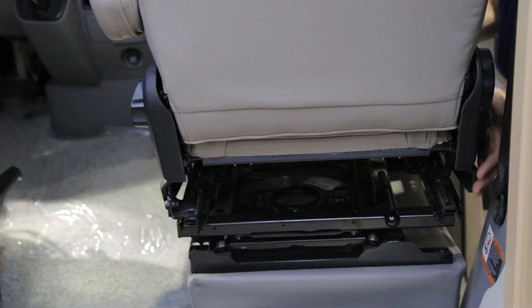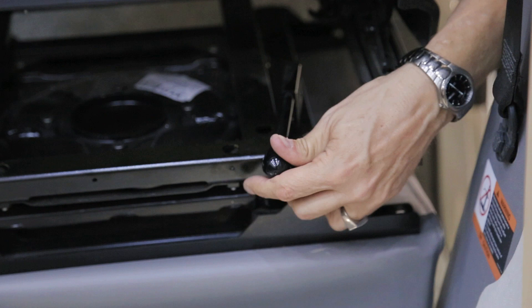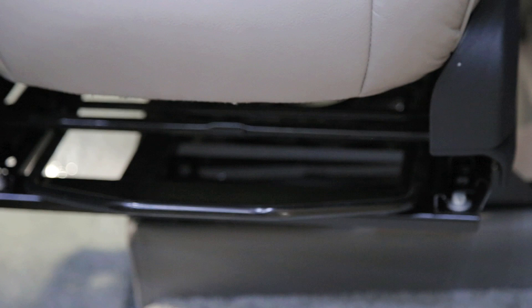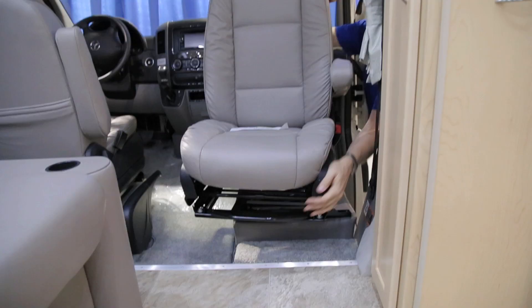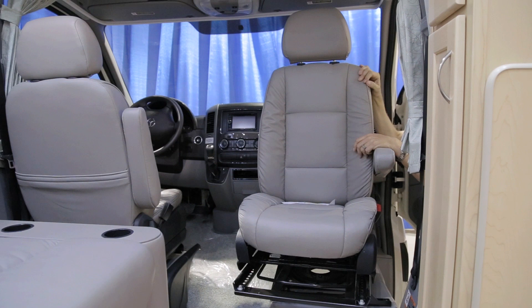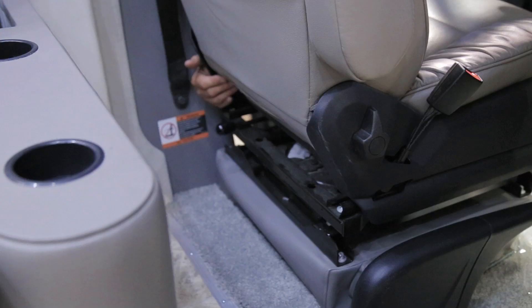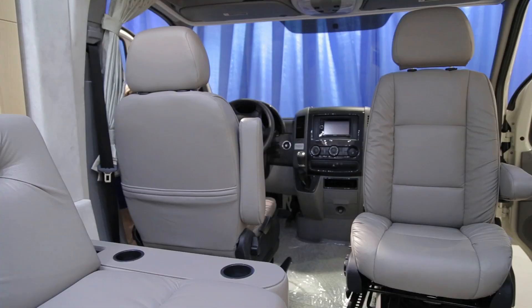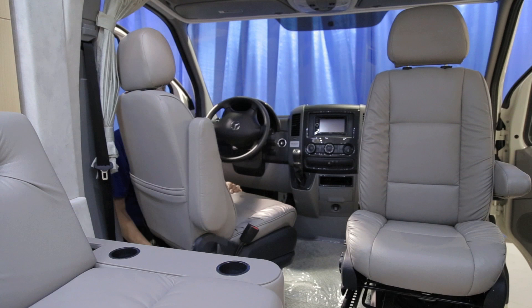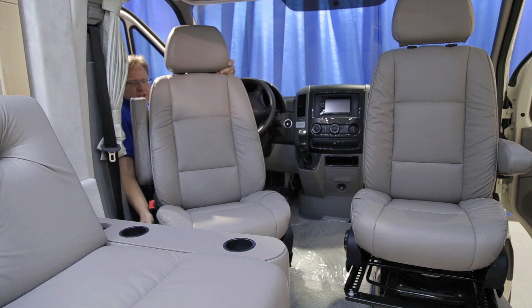To swivel your passenger front seat, slide the seat into a neutral center position, release the swivel from the back end of the seat, and swivel with the backrest toward the outside door. Once swiveled, re-engage the slide and slide the seat back. You can also tilt the seatback for desired comfort — convenient for watching television or visiting with people on the electric sofa. To swivel the driver's seat, slide into a neutral position, release the handle at the back, and swivel the backrest toward the outside. Please be aware the steering wheel is the limiting factor for positioning the driver's seat.